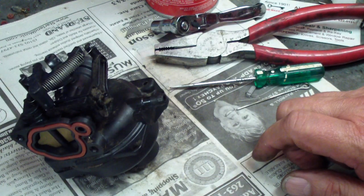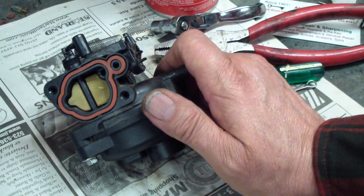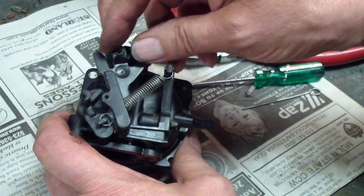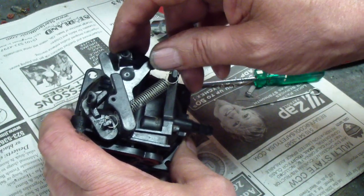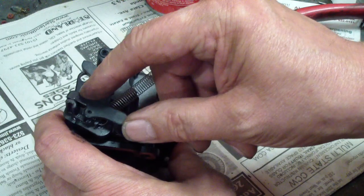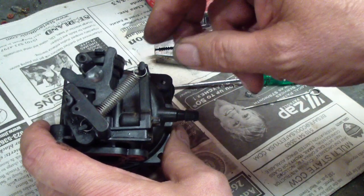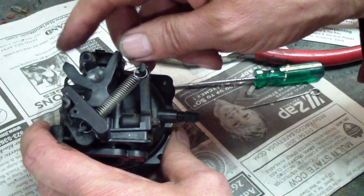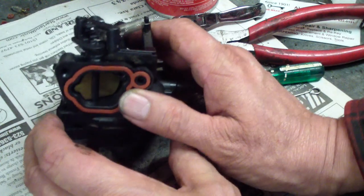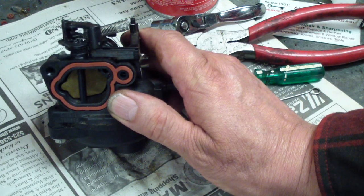Go put it back on. When you put it back in you've got your throttle, which you have on both the primer and the automatic choke models. On the automatic choke models you have this lever here, which goes back to your thermostatic control on your muffler, and then this goes to the throttle and to the governor, and there's a spring there — it only goes one way. I hope this video was of assistance to you. Happy mowing!